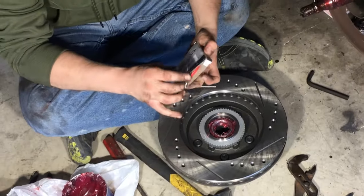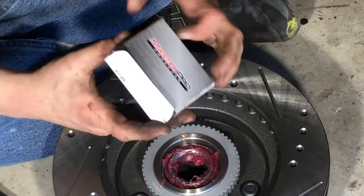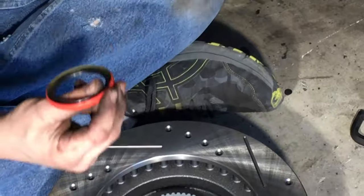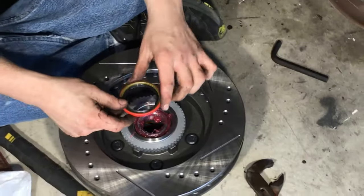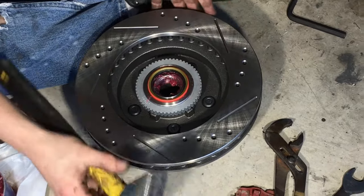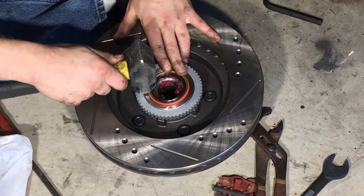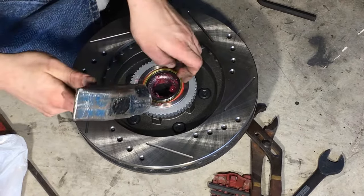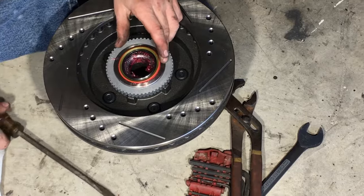Now get your wheel seal. I got the Master Pro since it's just a seal, so it wasn't too big of a deal — I didn't go with the higher end. The part number is 4739 from O'Reilly's. It's going to look like this. Go ahead and put it right there on the wheel. Get a hammer, but don't hammer it crazy — you don't want to ruin it. You want it evenly distributed around the wheel bearing, otherwise it's going to go in crooked and cook it.